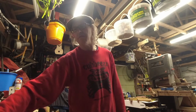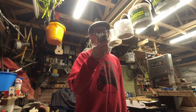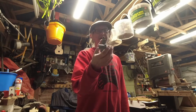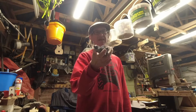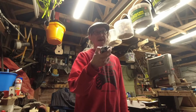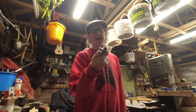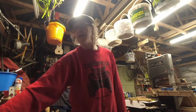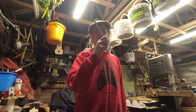So then I thought, maybe I've got a fluid lock in the hydraulic system and it's not returning the fluid out of the cylinder. So I cracked the bleed nipple, made no difference. So I pulled the cylinder apart, no problems with the cylinder. I tried putting it together without the ball bearing again, it all went together and the clutch worked. That led me to one conclusion. That rod, for some reason, is too long.